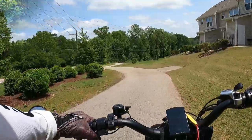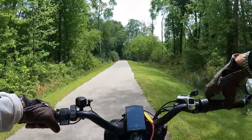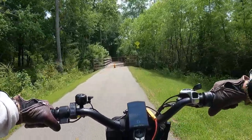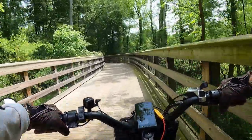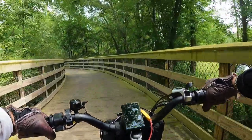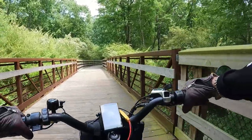Mid drives have a lot of torque and power, but it's all based on the gearing of the bike. With dual motors, gearing doesn't matter - you just hit the throttles and go, no shifting needed. I did not build this all-wheel drive Cobra with speed in mind - I could care less about speed on this bike, I've got the Citizen bike for that. I built this with the idea of making it a better off-roader with all-wheel traction, kind of like a lightweight dual sport motorcycle.